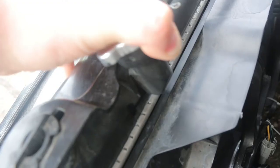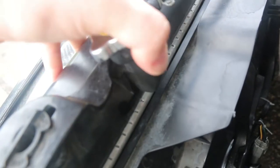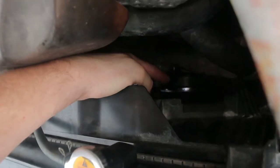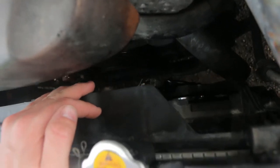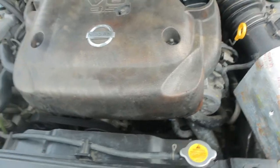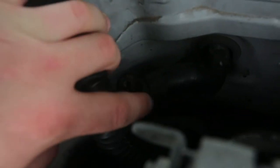This is my problem right here. Let me get some light up in this. I don't really know if you can see this that well, it's hard to see on camera, but right here the radiator's cracked. Before, the problem with this was the fan motors went out — at least this one did anyway. I replaced it, it overheated, and I had to make my own tabs for it. As soon as I was bleeding all this, it was running for like 20 minutes. Got the release valve back there, then I just drove it down the street — next thing you know, pop the hood, smoke everywhere, radiator cracked.